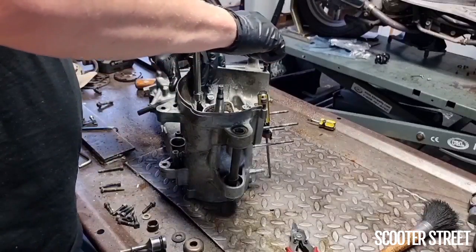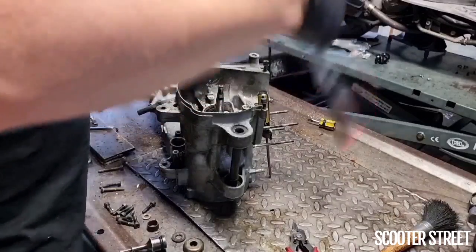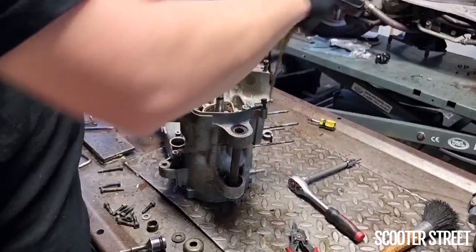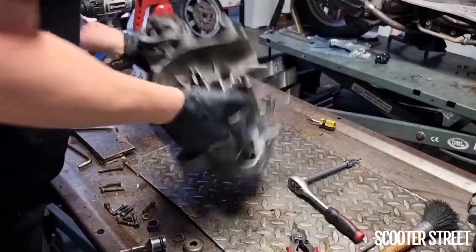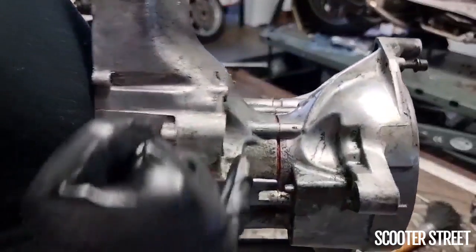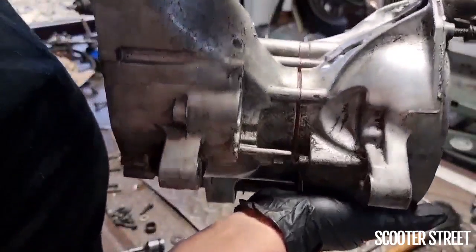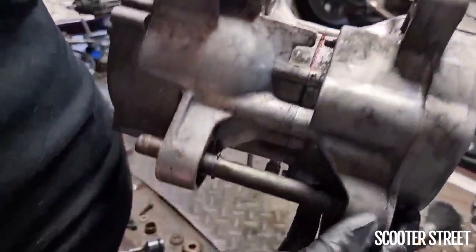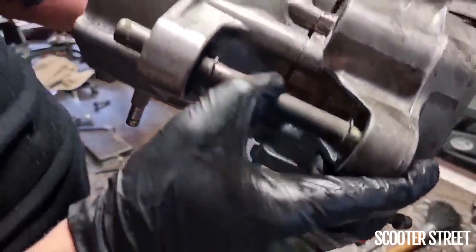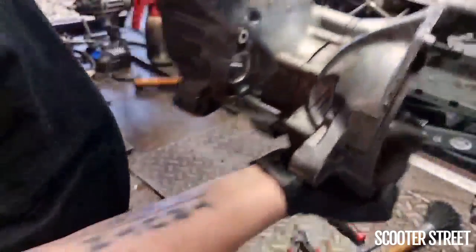So I'm pretty comfortable that has seated nicely. The next thing I check out is squeeze out, as I mentioned earlier. So here we go. This is what I mean by squeeze out. So you'll see all the way around the casing. Obviously this has a little bit of a lip from manufacturing, which is normal, but you'll see that squeeze out of that gasket glue pretty much all the way around. I didn't put any gasket glue on that outer bit there, but all the way around, which means we've got a really nice seal.